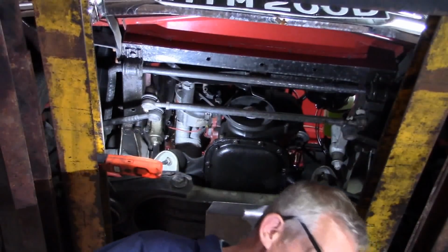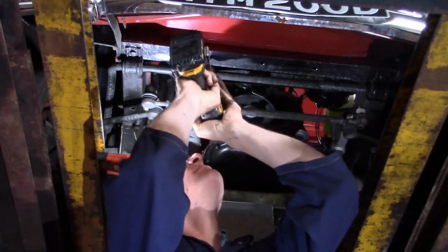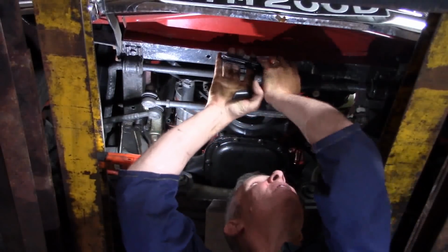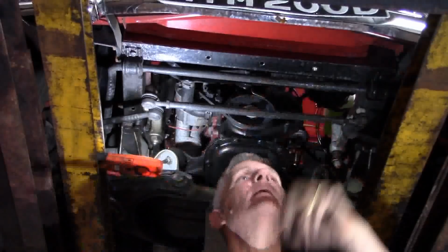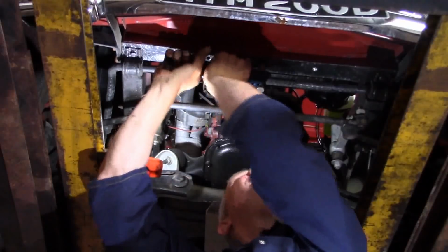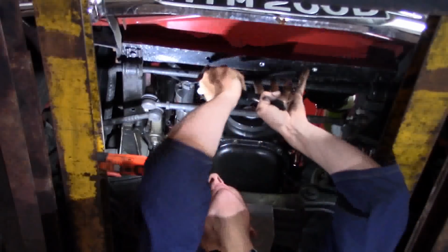And then I just like to go through lightly with a countersink. There we go, lovely smooth surface. And we pop the riv nut onto the gun, wiggle it into the interference fit, and carefully compress it up. There's one. Two. And final riv nut.